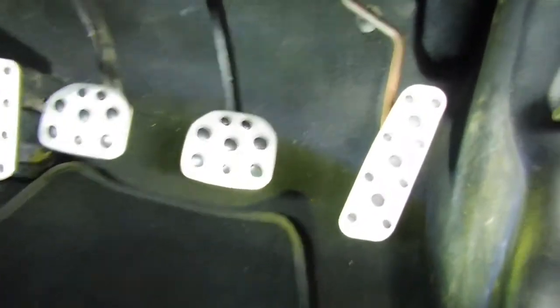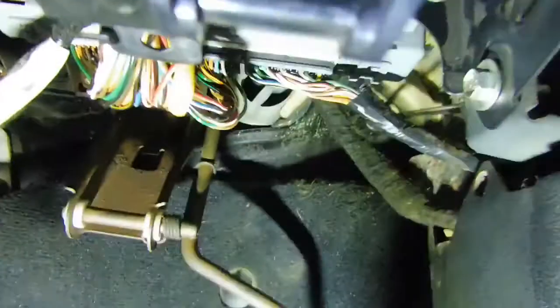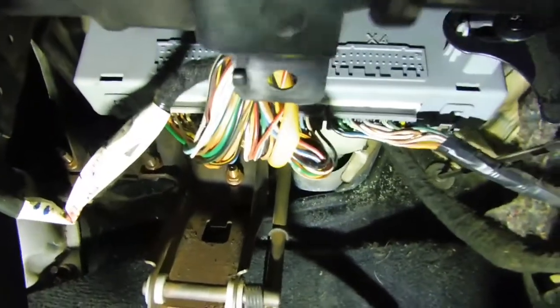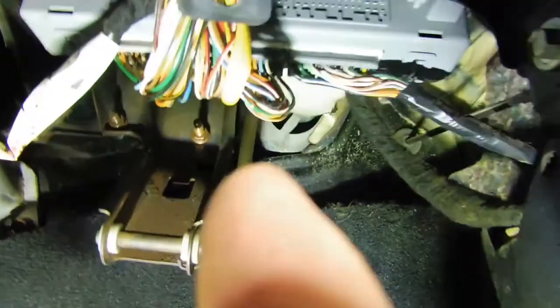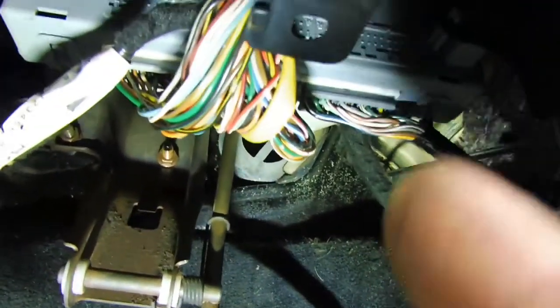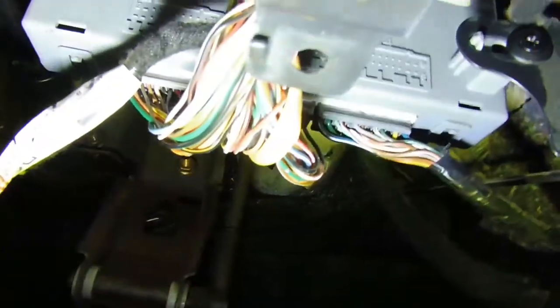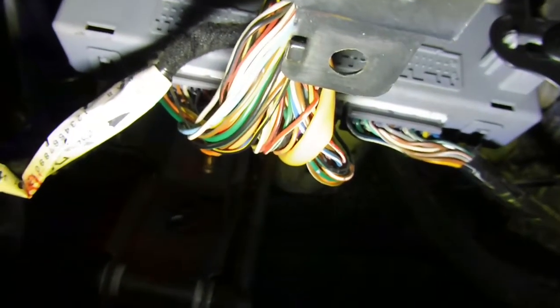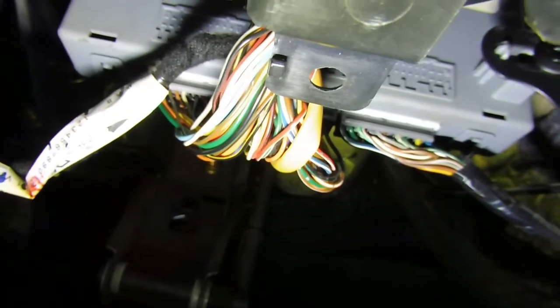Your body control module lives above your accelerator pedal. You can see that grey box there. There's 4 plugs across the bottom you undo. There's one of them speed clips just in the right hand corner there, you see it. That's all that holds it in. You undo the plugs, undo that, pull it down, she'll come straight out, swap out your V8 one.